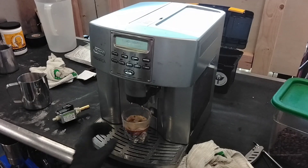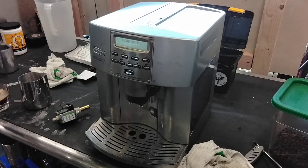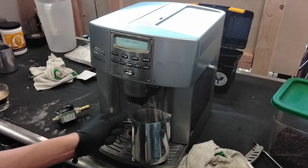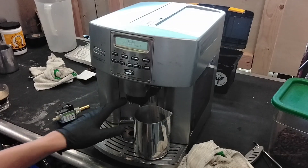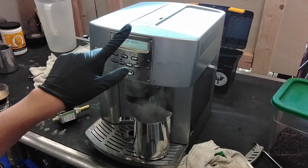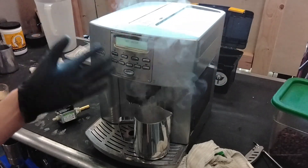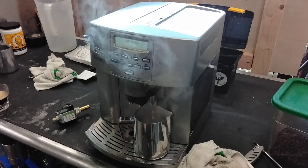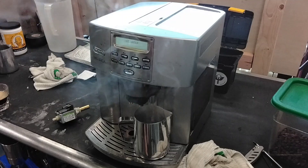As you can see, they brew fine. We're going to quickly test the hot water because I have a few points to mention. You may need to descale this machine quite a bit since it was in storage for a long time. The rinsing on the group head is completely unclogged, but the hot water output is somewhat clogged. The way it's acting is an indication that there's probably scale buildup within the steam side of the generator.